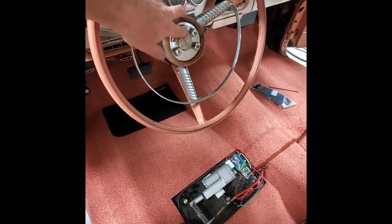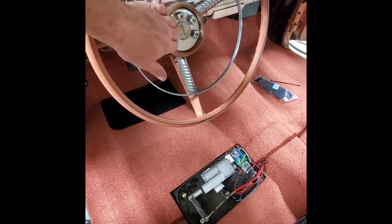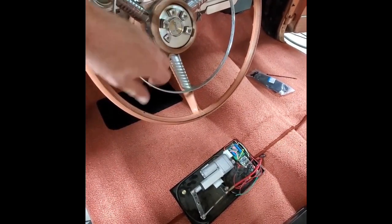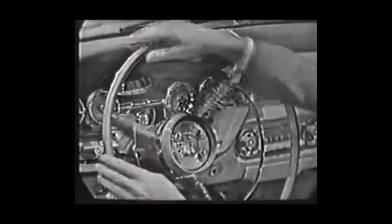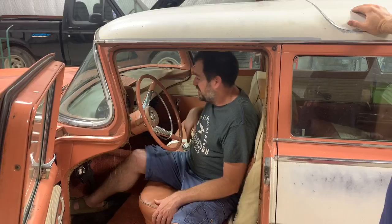What that means is I used modern electronic components and an actuator that uses a cable to shift your transmission. So when you hit these buttons, instead of using what the original used — something similar to a windshield wiper motor — this uses a modern actuator so you can reliably shift to any gear. It's a few hundred lines of code with safety features: it won't allow you to shift to the wrong gear while traveling, it uses a vehicle speed sensor in the transmission, and it makes sure you're holding the brakes when you shift out of park. You can keep both hands safely at the wheel and shift at the same time.